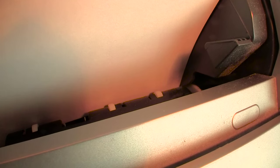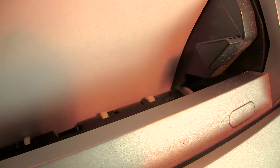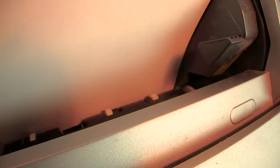If that roller gets a little bit glazed or slippery or dirty, full of paper dust and such, it will not properly grip the paper and it needs to be cleaned. And the way to do that is with alcohol and a Q-tip, or you can soak a piece of paper halfway and then have it fed through the printer, and the wet alcohol-soaked paper will pick up any dirt and any particles that may have contaminated the surface of the rollers. That's one quick way to clean your rollers. A lot of feeding problems can be cured by simply doing that. Now, there are products specifically made for that, and you can obtain those from some of the third-party ink providers.